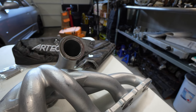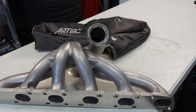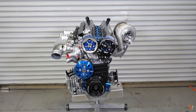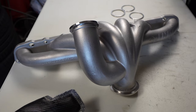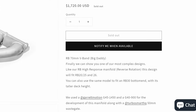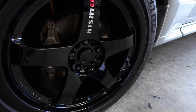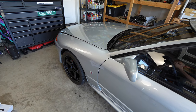The external wastegate is designed to accommodate 44, 45, and 46 millimeter wastegates. The internal wastegate runner is designed to accommodate up to a 50 millimeter wastegate, however you will have to cut the flange off at the end. This manifold is designed to work with as small as a G25 Garrett turbo all the way up to a G35-1050 or Precision Turbo 6266 and 6466. For bigger turbos, you can get up to a 70 millimeter V-band, holding everything from the Garrett G45-1450 to the G40-900 and Precision Turbo 6870, 6775, with testing for the 8685 coming soon.